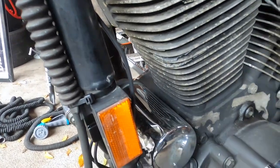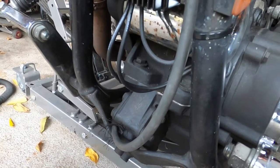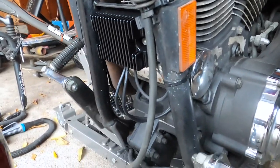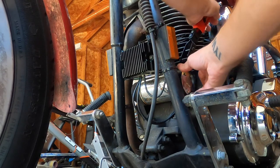We had to run to our local parts store - because we support local - and got the correct size filter. Even though the one I had could fit all Evos, I wanted the one specifically for this bike. We'll take this off, catch the oil in our little catch pan, probably lay down some rags so I don't have to do too much cleaning. Just spray some brake clean on there, it'll take care of it pretty nice. Put the new one on, fill it on up, fire it up, probably go for a quick rip.